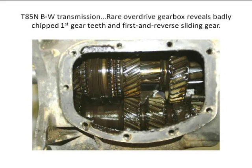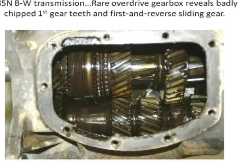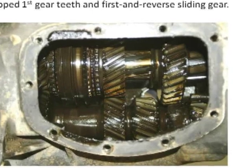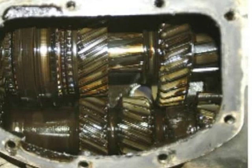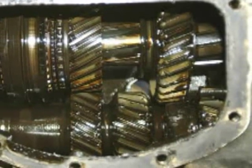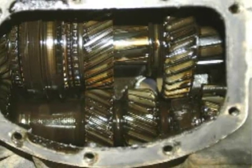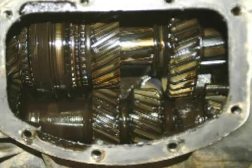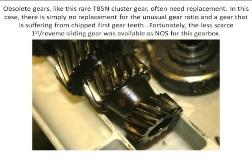It's unlike the T-89 — if you're familiar with the T-89, it uses a sliding gear that has straight-cut gears. This gem has helically cut gears, and if you think about it logically, the sliding gear means you'd have to have the transmission absolutely stopped when you go into first gear. If it's moving at all, you are going to have a clash between the reverse and first sliding gear. So by design, this is a failure-prone cluster gear that is now virtually obsolete.